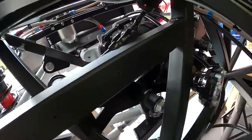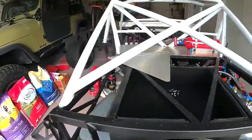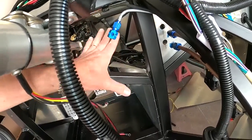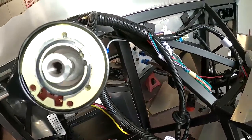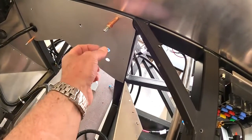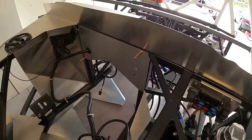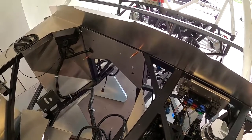I started running the tubes. This one runs down here, up underneath the tube - I still need to straighten it out and get it connected - and then it's going to come up into here. This could spray up underneath the dash into the whole brake and foot assembly and back this way, so I think that's the best way to keep the driver safe. For the driver's side I'm going to come in here and do a little 90-degree turn, putting the nozzle right here to cover both headers and the fuel system.